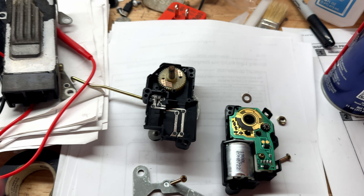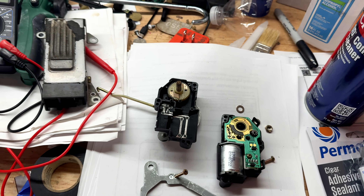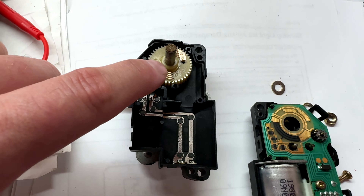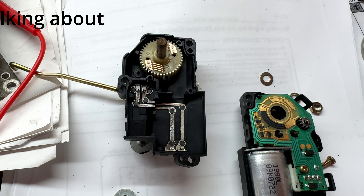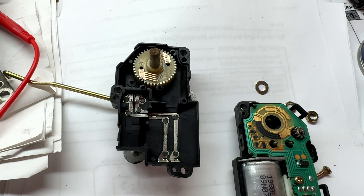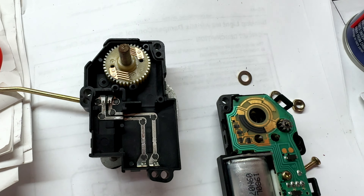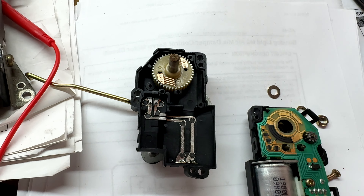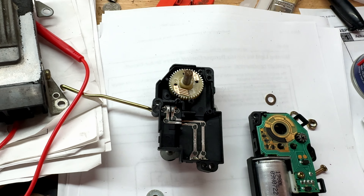I bought the RTV version but I'm going to need basically none of it. These fingers here get gummed up — this is the sensor. When you have increased resistance, or at least the way I understand it, the gunky buildup on here makes it difficult for this motor to sense where the actual blend door is located in the box, which then causes issues.